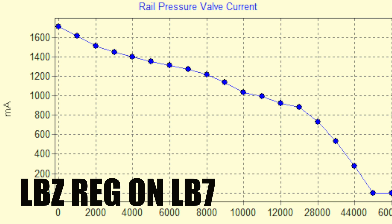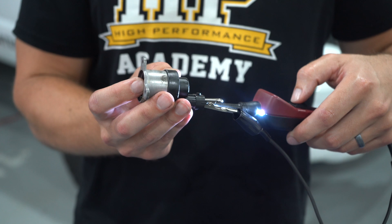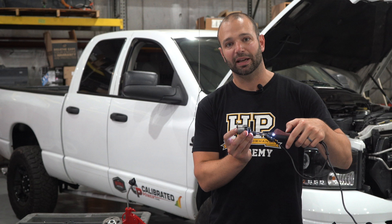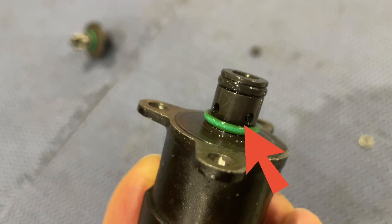Let's watch the slide move because that's neat. If you look at my index finger, that would be the end of the regulator. Up against that end would be the spring, and then the slide would be forced back by the spring. When I apply 12 volts, that slide is going to be at its lowest orifice — the least amount of fuel flow — and you can see my fingernail all the way out to the right. As I let off, my finger, acting as a spring, forces the slide to the left. As it moves to the left, you get more orifice flow, and that orifice flow allows fuel to go in the end of the regulator and out these four holes around the outside.